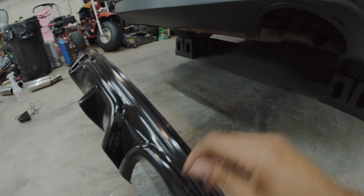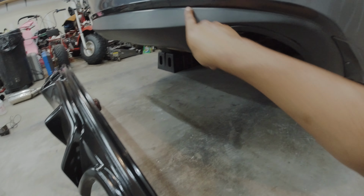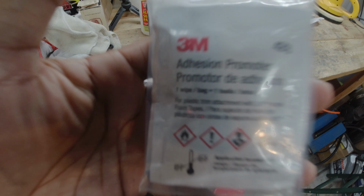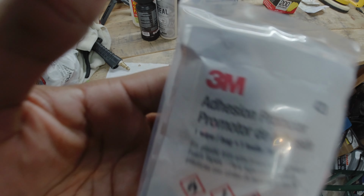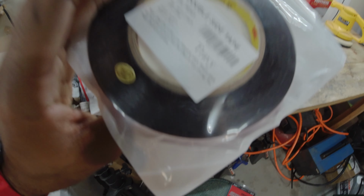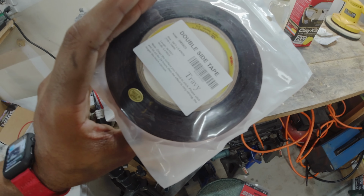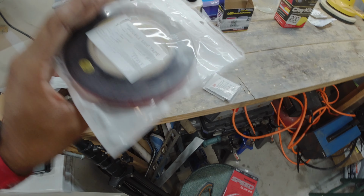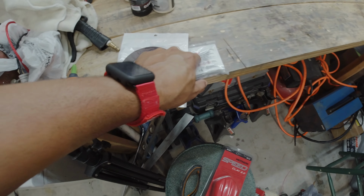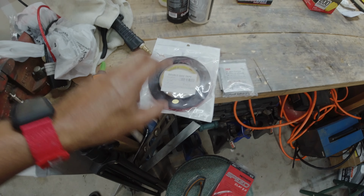So I'm just gonna take my alcohol, my IPA, and wipe off the surface on the bumper. Wipe off the surface on the inner lip. Use 3M adhesion promoter, and I will put a link in the description below. If the link doesn't work, just let me know and I'll find a new link. And then I use 3M VHB. VHB stands for very high bond, and it is way stickier than the regular 3M tape. So 3M adhesion promoter, 3M VHB.